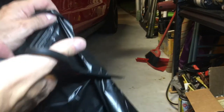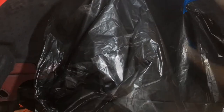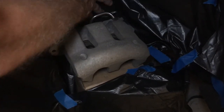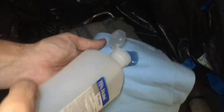To prep the area around the caliper, you could use a garbage bag cut open to make it flat, or you could use a roll of plastic. Using painters tape, tape the plastic to the wheel well, making sure the plastic covers all components except for the caliper. I used a cardboard box to sit the caliper on in order to relieve tension off the brake line. I then taped plastic to the box so that I didn't paint the floor by accident. Make sure that the plastic isn't touching the caliper.